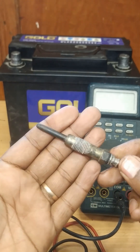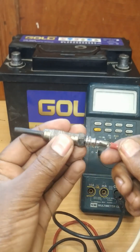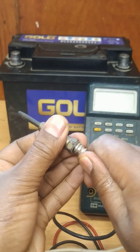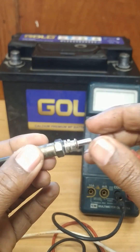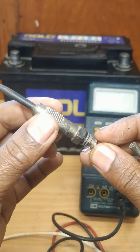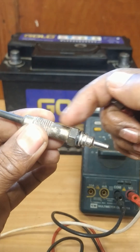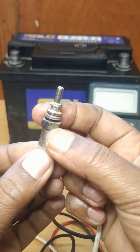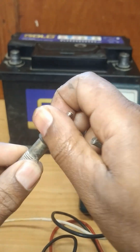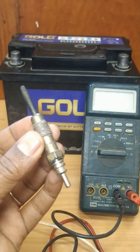The coil will become red hot when heating, causing the combustion chamber to become hot, which assists in cold starting. Now, how can you inspect this? The glow plug has a positive terminal right here. When tightened onto the engine body it gets grounded. There is an insulation — that black ceramic piece — preventing the positive from directly shorting to ground.